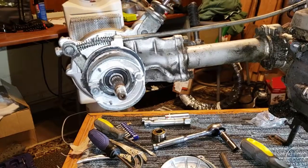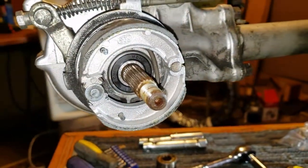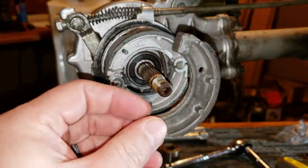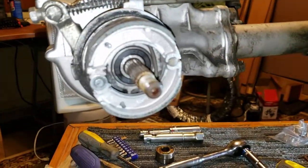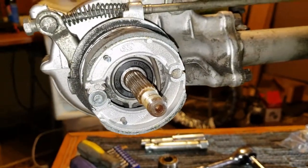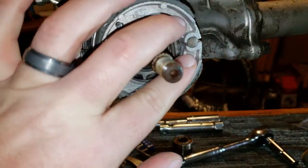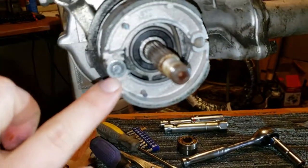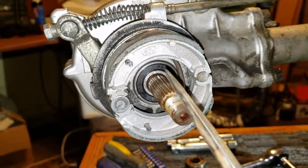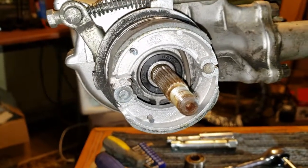I got the new brake shoes on there — sorry I couldn't film that. These were the old brake shoes. Basically it's got that U-shaped spring behind it and it was impossible to do and tape at the same time, but I got these two U-sides on here, got the bottom piece under there, and had to just pry this up and around with a screwdriver. It took quite a bit of force to do it.